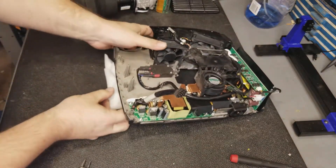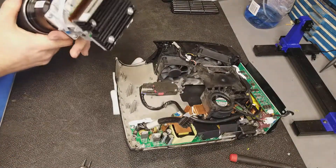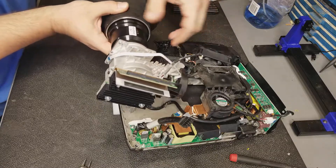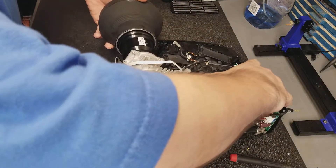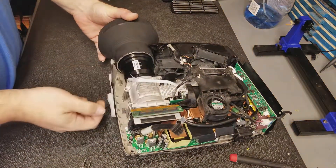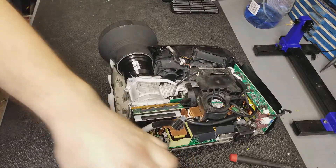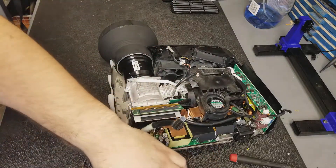I'm going to use that foam block under there because that lens is going to kick up part of the projector, so I want to make sure this goes in smoothly. I'm not taking this out — I don't need to. There's a safe amount of flex and it keeps me from having to remove the front as well. You just only need to lift up a very tiny bit and then just tilt, kind of slide that under. Watch that cable. Then it drops down onto the three standoffs — those are the shorter T8s, there's only three of them.